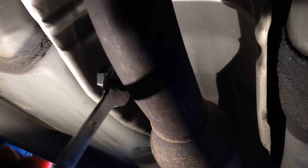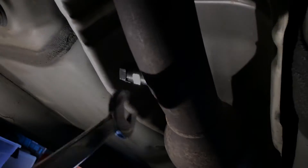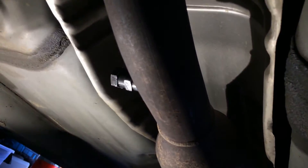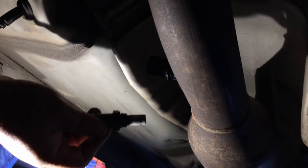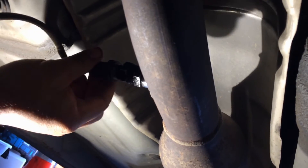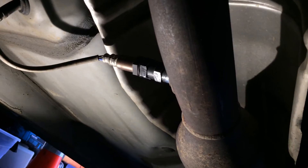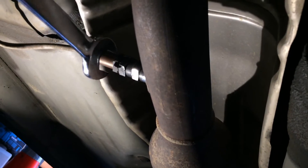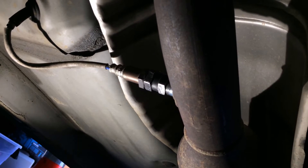This is also 22 millimeter. Make sure that's tight — you don't have to superman it or anything, just make sure it's snug. I'm going to twist my O2 sensor up before I actually install it. I twisted it the wrong way, so now I'm twisting it the right way. Put the sensor in place and tighten it up, snug it up.